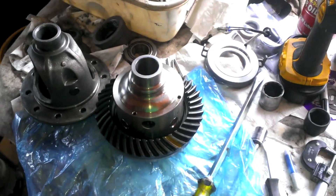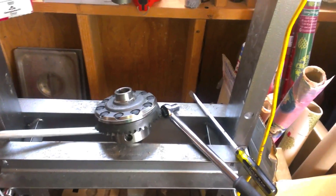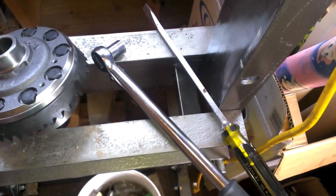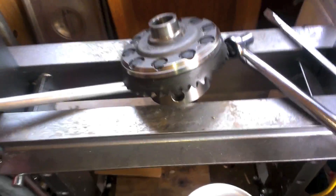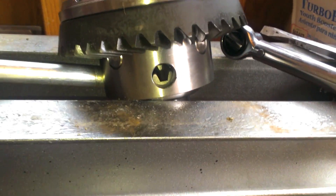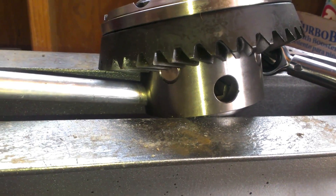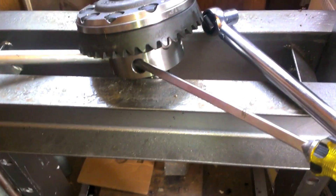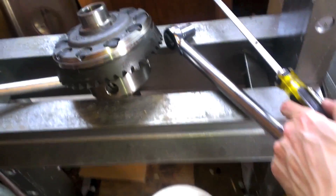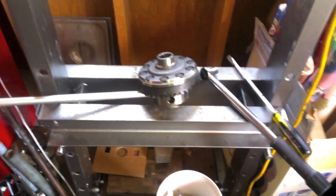And it won't be fun. Torquing this thing down was not nearly as easy as the other version. With this carrier, since it's got two flat spots you can just put it in a vise. This one was even harder than the Dana 35 because it didn't even have the provisions — I couldn't stick anything through there. So I got a pipe that was about the same diameter, stuck that in there. The pipe was a little flimsy so I also had the biggest flat head I could find wedged in there. I don't think I damaged the case too much and I got the bolts tight — I guess that's a job well done.